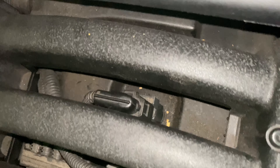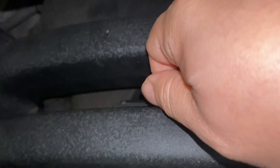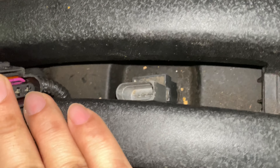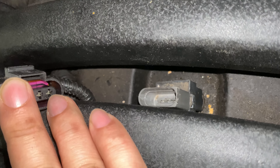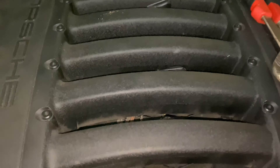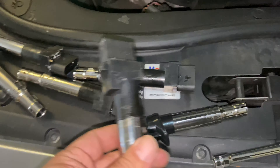Some of them might just pull out, but if you go all the way to the back, that little tab is on the back side. You need to fish the wire tool down there — a lot of times it's good to turn it sideways and then rotate it in to get it under the hook. Once you pull up, that clip comes right up. You can then use a screwdriver or pliers to pull the lead out. Once you get the leads off, pull out those ignition coils — I had to use adjustable pliers because they are on there tight.